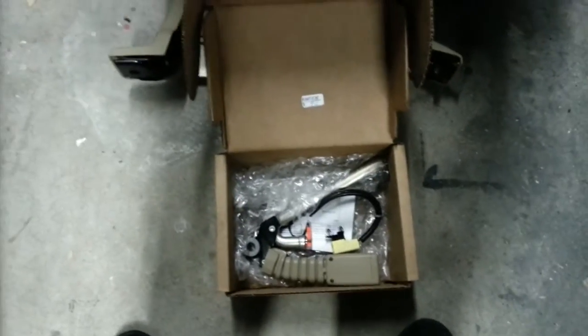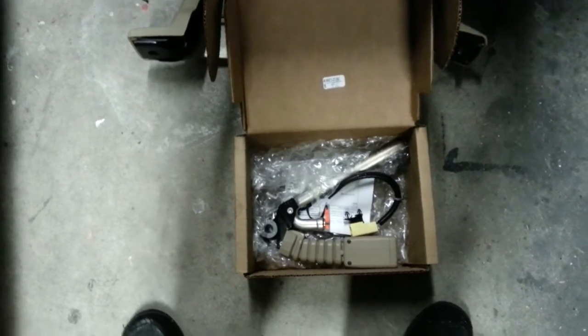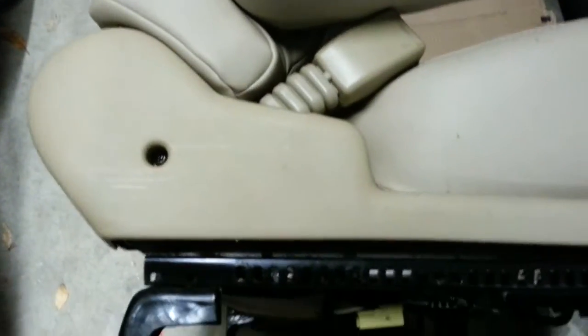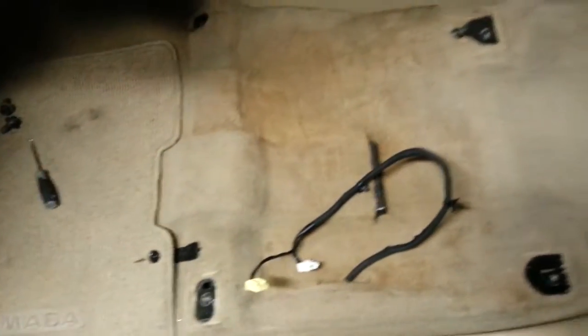Here's a little video on how to fix the airbag code. This is the seatbelt retractor buckle, not to be confused with the seatbelt retractor. It's basically underneath this cover here — you just pop out the seat, four bolts, two wire harness connectors, pretty easy to take out.